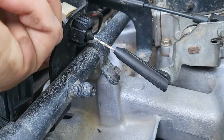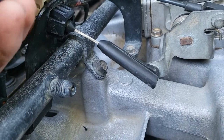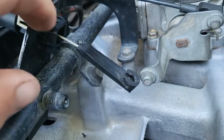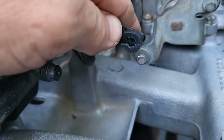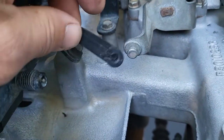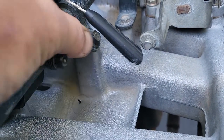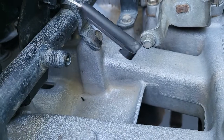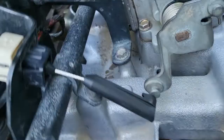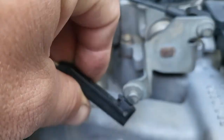Alright, let's start off by just putting this the way the factory says. Release the clip. Now, pull this guy off of here. What you want is the center part of this hole where it snaps in to line up with this little crank here. So push this forward until we get it to line up. So what we're looking for is that when this thing's locked down, this guy just lines up with the bell crank.